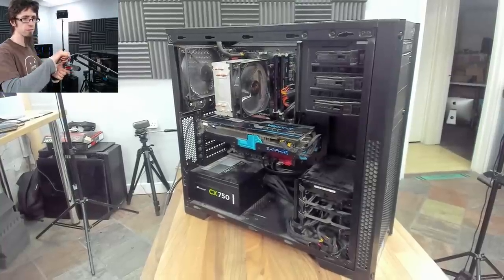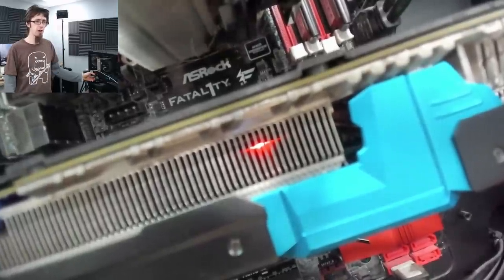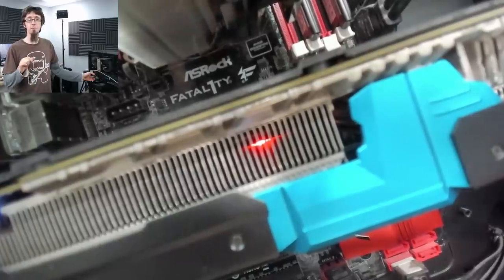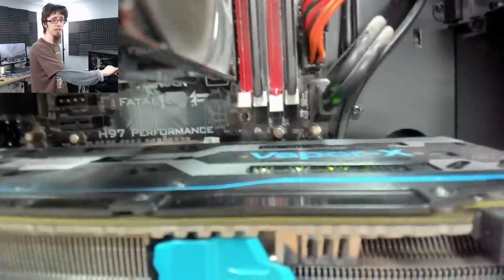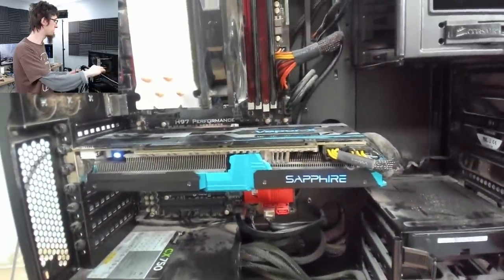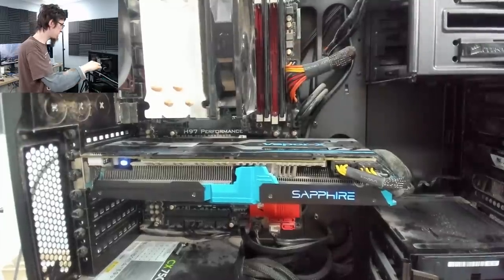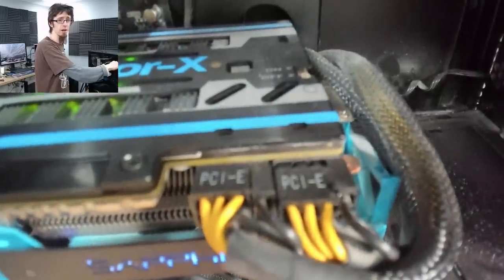Let's go in for a closer look. You can see there's an LED shining through the fins of the graphics card heatsink. That LED is actually at the PCIe x16 slot — it's very difficult to see from the outside, but it's next to the PCIe x16 slot, and it's on, which suggests we're stuck on VGA.